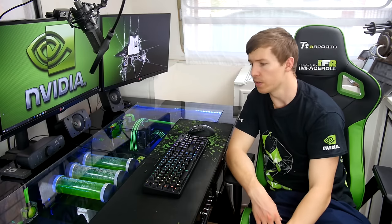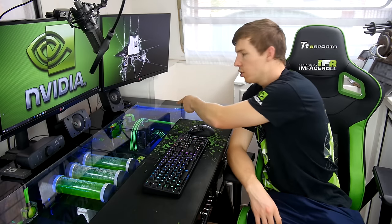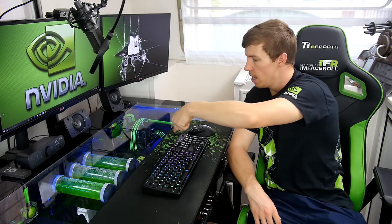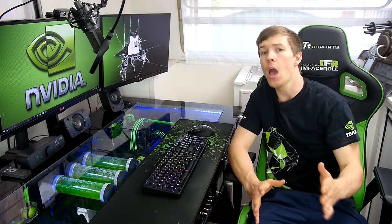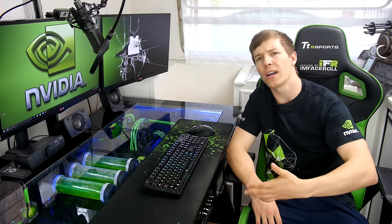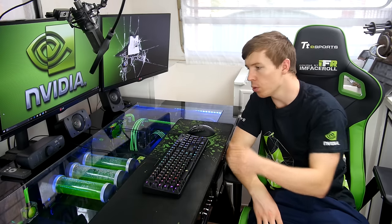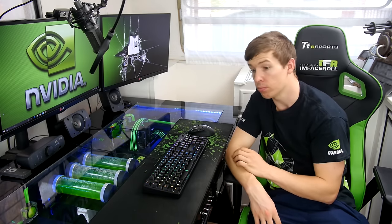Yes, the hard drives are liquid cooled with water blocks, but this is purely for aesthetics — they don't need to be. The tube coming from the CPU would have looked untidy going around without them, so the water blocks break up the loop and fill the space nicely. We're using Mayhems UV green dye along with biocides and kill coils to stop any growth. The majority of the liquid cooling hardware is from PrimoChill — their flow meter and ghost compression fittings in a clean black color that suits the build theme.